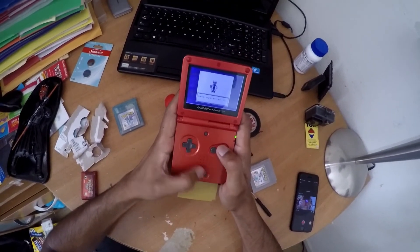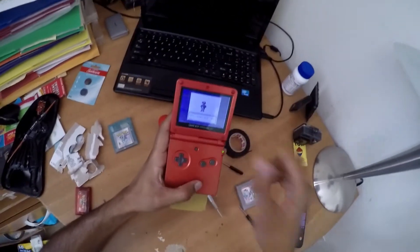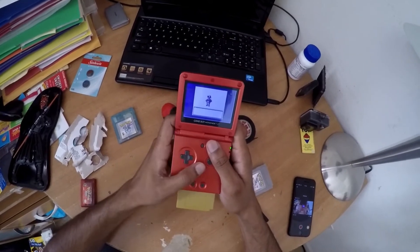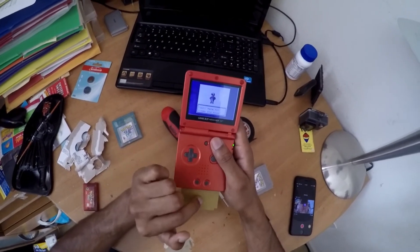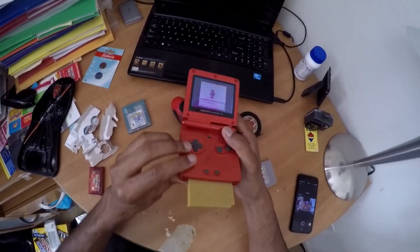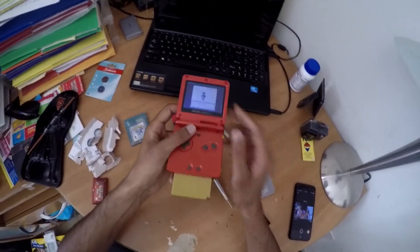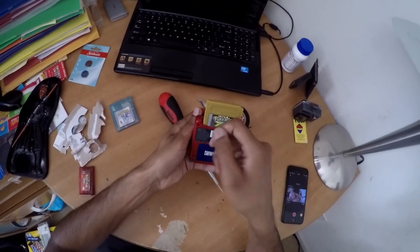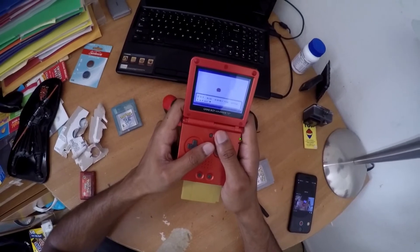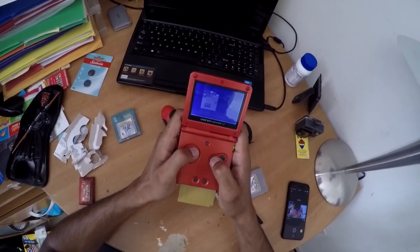But if you are interested in saving it, there are a couple things you can do. You can look on eBay for that little device. Or there's another way where you can actually have the game in, turned on, open the cartridge — I think it works better on the Game Boy Advance — but you can have it out and open, and just do the change while the game is playing. Once the battery's all back on, you can save and your progress will still be saved.